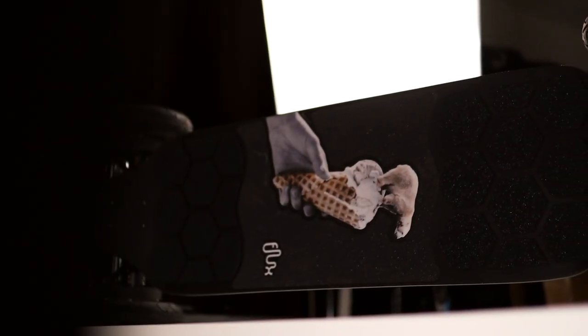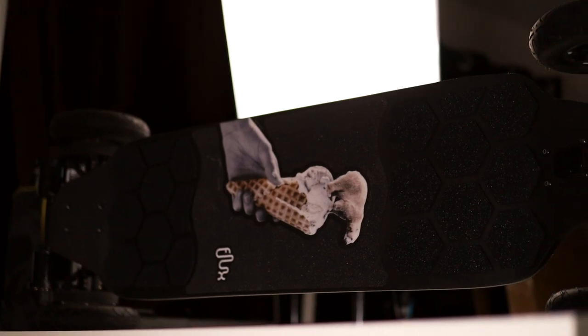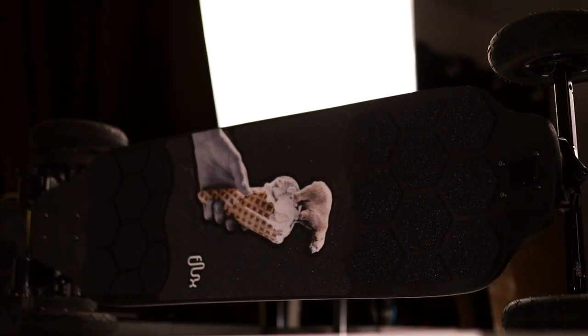If you're getting the Atlas AT, whether with on-road or off-road wheels, they will use inner tubes inside. And that opens up the possibility of having punctures now and again if you ride over sharp objects. Now this isn't a huge deal at all. Every AT electric skateboard on the market worth its salt is using pneumatic tires. It's not a difficult process at all to fix a puncture with the Atlas. It certainly didn't take me a long time to do. You can also use tire sealants like green slime to prevent future punctures and help you stay riding for longer.